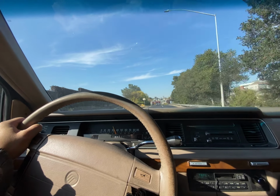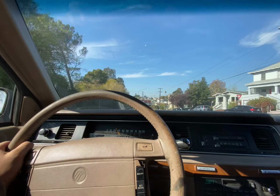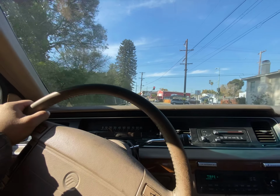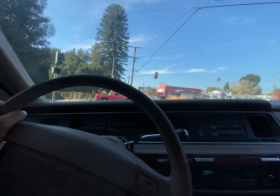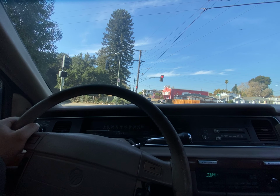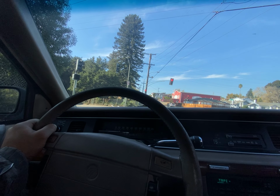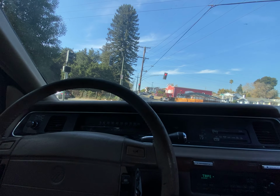Well, also, usually on these Fords, if you got something bad and you disconnect it, it usually runs better, because the computer will just ignore it. It uses default settings? Yeah. Throws in a more rich mixture and makes everything run better? Yeah, because I had a '94 Lincoln, which is a Ford. The mass airflow did go bad. It acted kind of like this, and if you disconnected it, all the power was back.